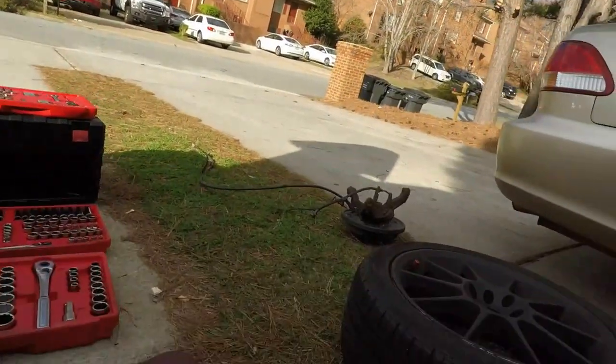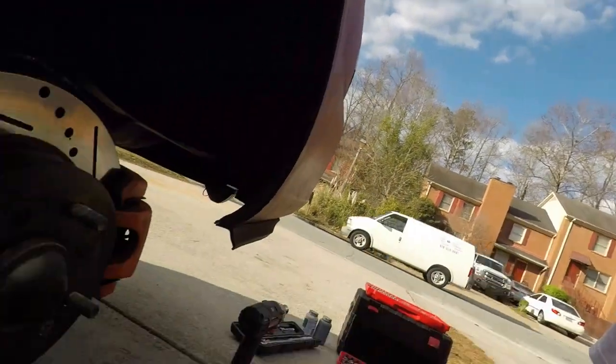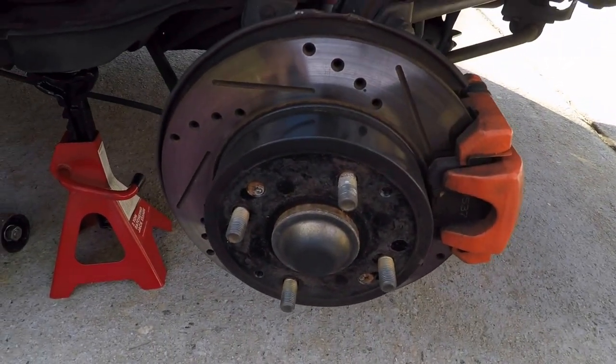This is the problem I used to have with this car in the winter. When it's really cold with those drum brakes, what happens is when I park the car and put the brake on, the next morning I try to drive it and it was difficult — the brakes get stuck. I'd remove the drums, clean them, make sure they weren't tight, but they always got stuck. I remember one time they just seized on me because it was really cold and I couldn't drive the car.